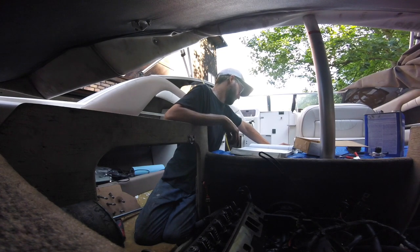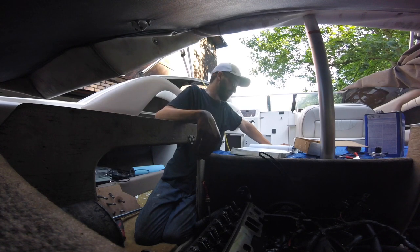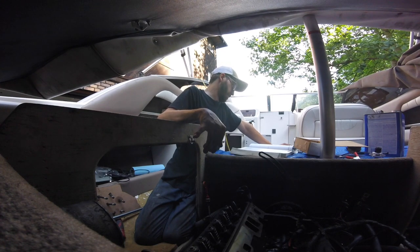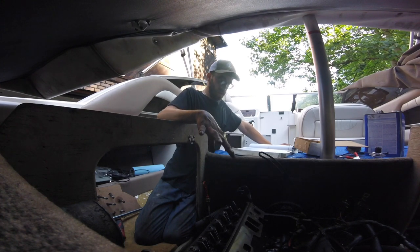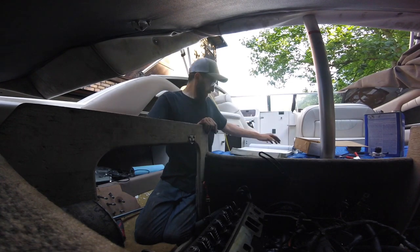Second pass, short bolts at 55, which is the bottom ones. Medium bolts, the outer ones, at 65, and then the big top ones and middle center ones are at 75. So,